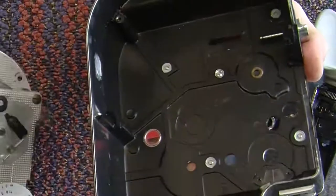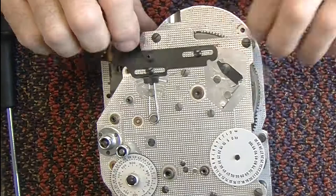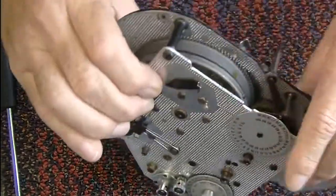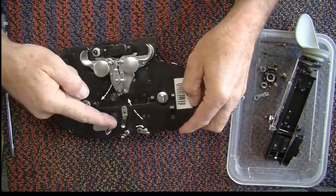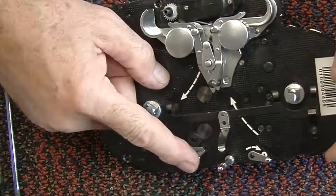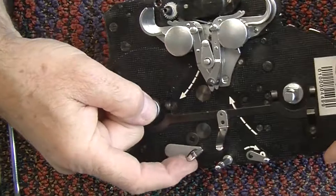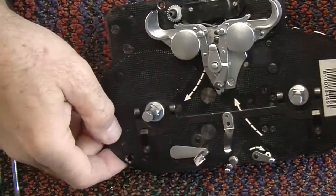There it is — the empty body, and there's your motor. This one looks particularly damaged because there are teeth missing on the spring motor, which makes it sort of useless — you can't even send it back to Bolex to be rewound. I haven't been in this one before, because whenever I do I remove this arm and just thread the hole. Students mistake this arm for the one that pops the spools out, and they grab it and bend it yanking on it. It then slips over its stop, and the take-up reel as it comes around binds on the edge there, rendering the camera useless.